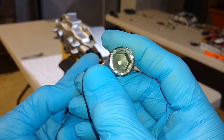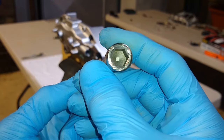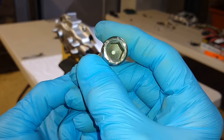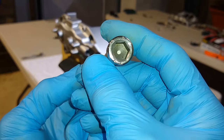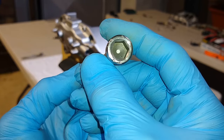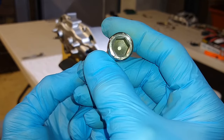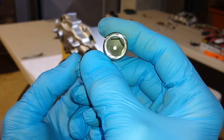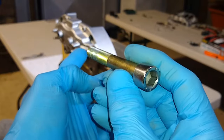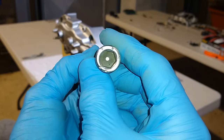The first one is dry torque. The dry torque is 88 foot-pounds. Then there is a lubricated torque. That torque is 66 foot-pounds. The manufacturer suggests that you use a medium viscosity oil for the lubricated torque, and they recommend always a lubricated torque. However, since we are using steel fasteners to aluminum parts, what I'm going to use is anti-seize lubricant.